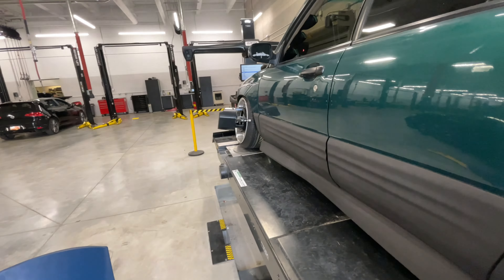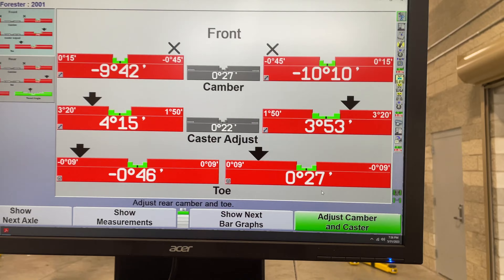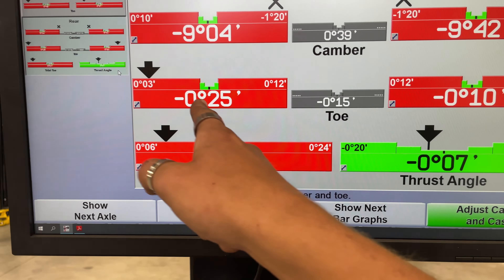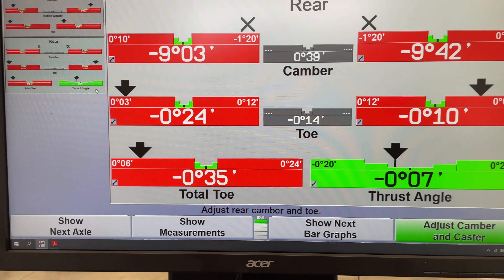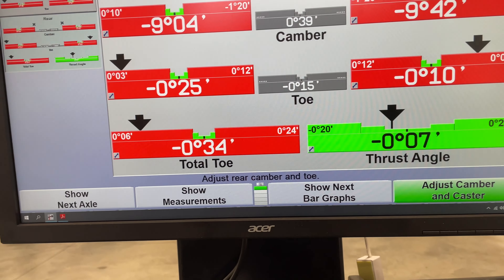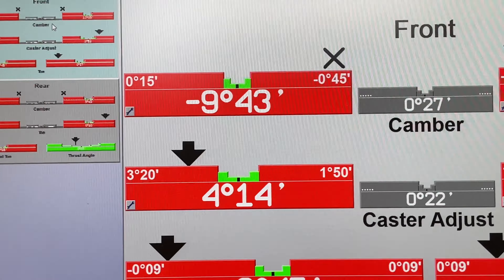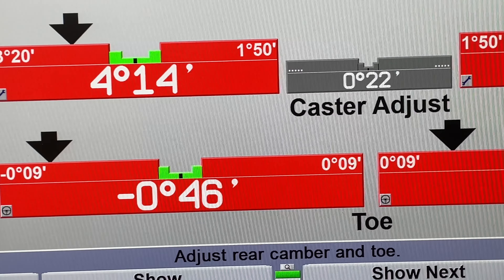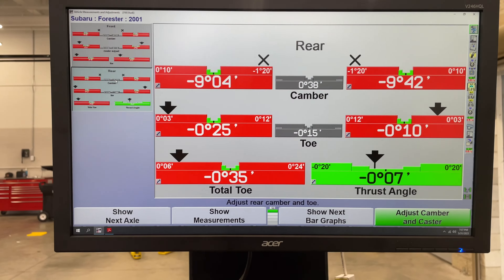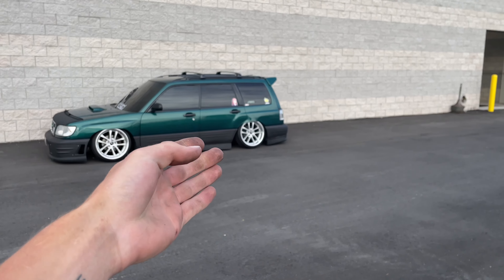We had to zip tie this one on — the others don't seem to clear enough. It's actually not as bad as I thought it was. The rear is worse than it used to be because it's seized — can't touch that. Front numbers: negative 10, negative 9.4. Rear: negative 9.04, negative 9.42. It's all within a degree — that's pretty good. The alignment is Gucci besides the rear, which is all seized as it always has been. Front alignment is Gucci.